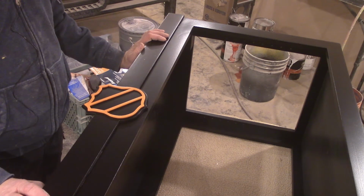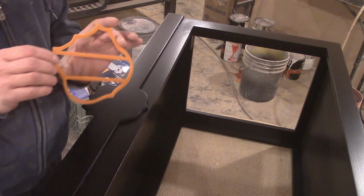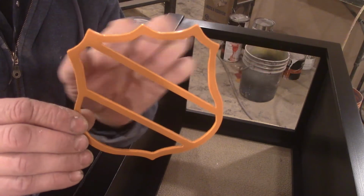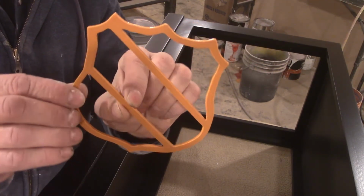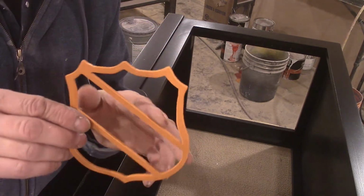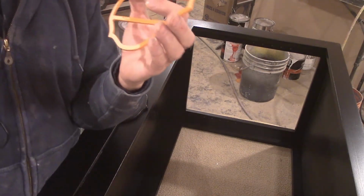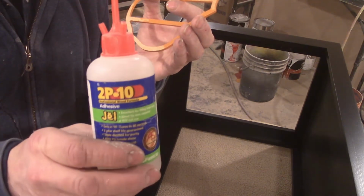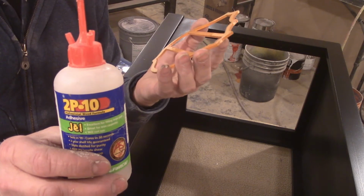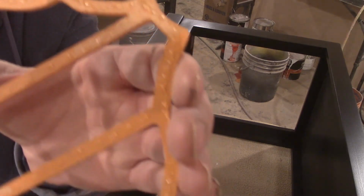So our first task is to glue this down. Now the concern is that this is a very small emblem and it has very small edges. It's very skinny. So we've got to glue the back and I don't want the glue to ooze out. That's our real concern there. And what I use all the time, if you've been watching my channel, is the 2P10 and it glues awesome. Once it sticks, you've got a few minutes to work with it, and then after that, it sticks really good. So I got a really, really small layer on there.